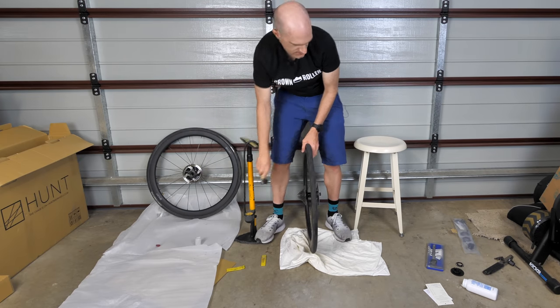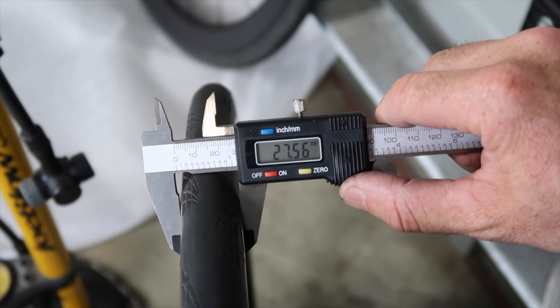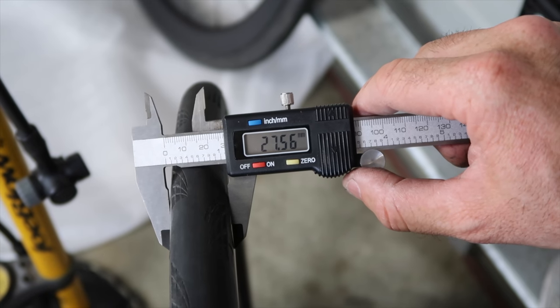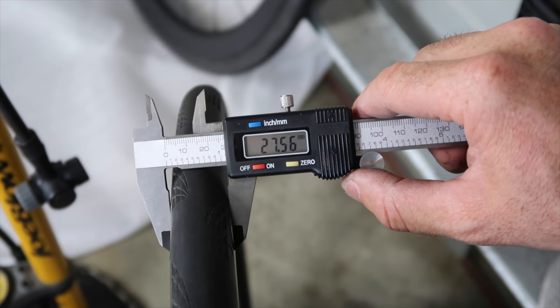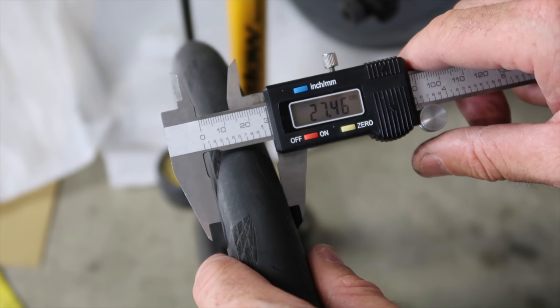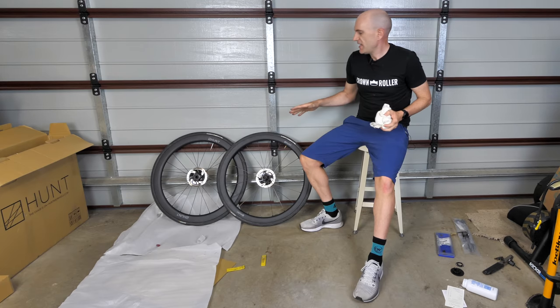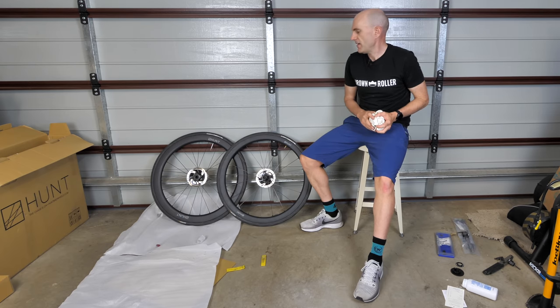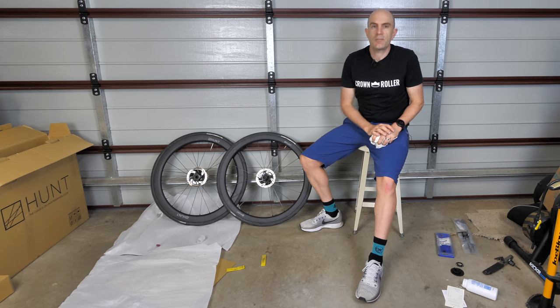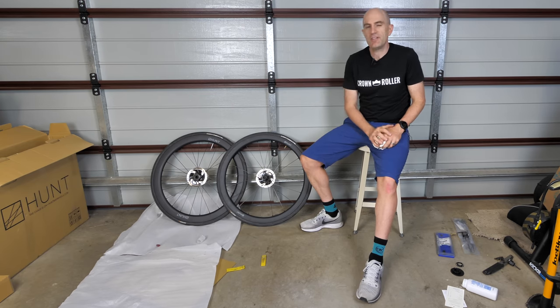At 80 psi on the back, let's see what they measure in at. Coming in at 27.5mm — not as much as I thought, but still a little wider for a 25mm tyre. With the front at 80 psi, 27.46, so about 27.5 on the front too, as we'd expect. So there we are — job done, wheels swapped over. Let's see how they ride out on the road. That internal rim width is what it was all about: fattening those tyres up, hopefully smoothing things out on the roughish tarmac here. I'll do a follow-up video on these as I have done with my other Hunt wheels after a few thousand kilometres to see how they hold up. Hit subscribe and be sure to hit that join button to become a member of the GPLama YouTube channel.